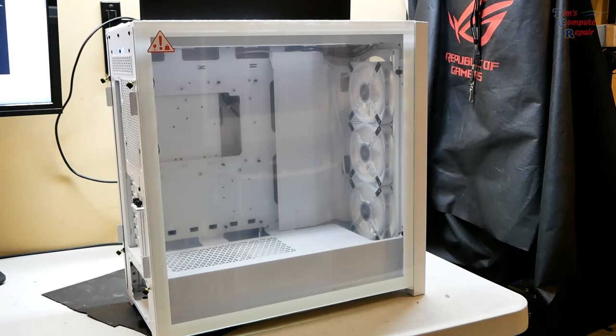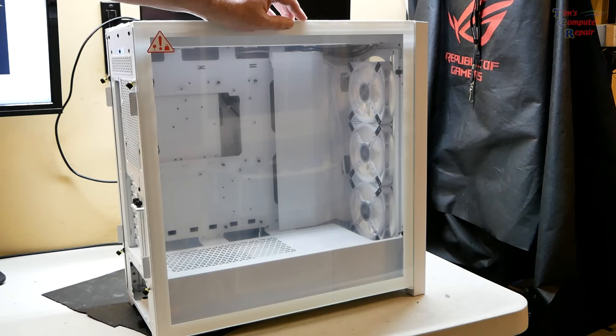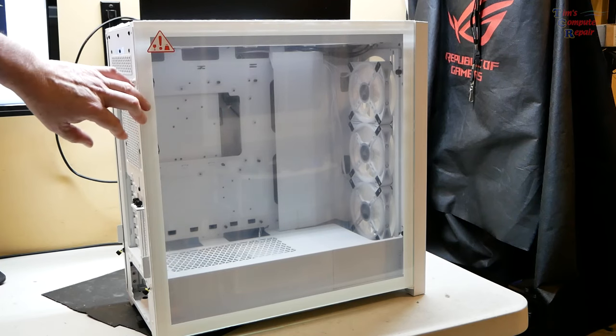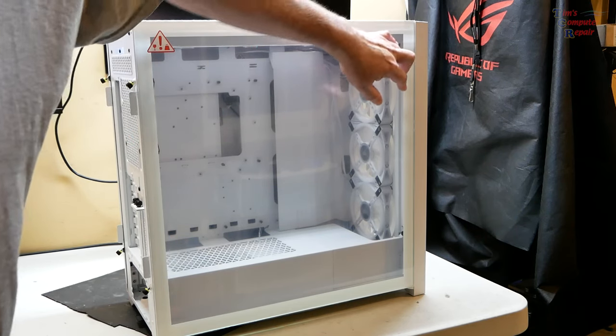Today, in this video, I'm going to be doing a Corsair themed custom built computer. And we're going to start off here using this case. This is the Corsair iCUE 500X RGB QL edition mid tower case. This case comes complete with the QL RGB fans. It's 120 millimeter fans. This case ships with four of those fans, three in the front, one in the back.